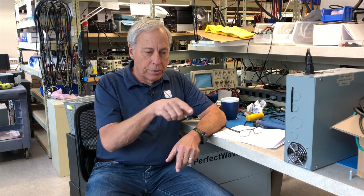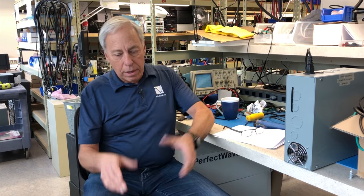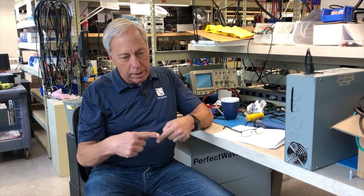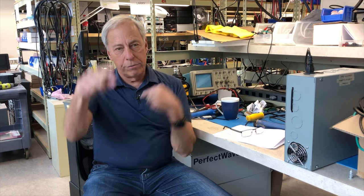Now you're going to start playing some music and walk around the part of the room where your speakers are. You go in back, you walk around, and you're going to find a place where that woofer really kicks butt, where that woofer is solid. Oh yeah, okay, this works. Now I've got that true extension down to 20 hertz, which we rarely get in a room. And you'll know it. You walk over here, it's not there. And you go over here, there it is. Mark that spot. X marks the spot. That's where you're going to put that subwoofer. You take it off your chair and put it in that spot. Now, when you reverse positions and sit in your chair, you will hear perfect 20 hertz sound, just as you did. There's no difference between being here in your chair with the sub there, or reversing positions.